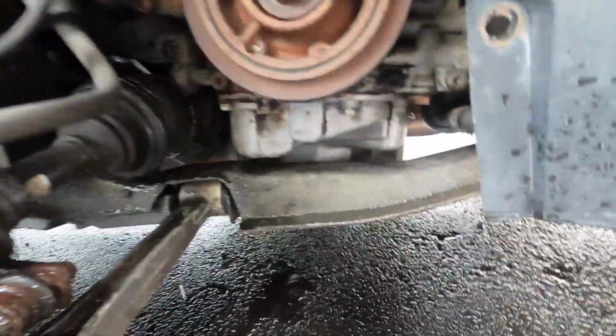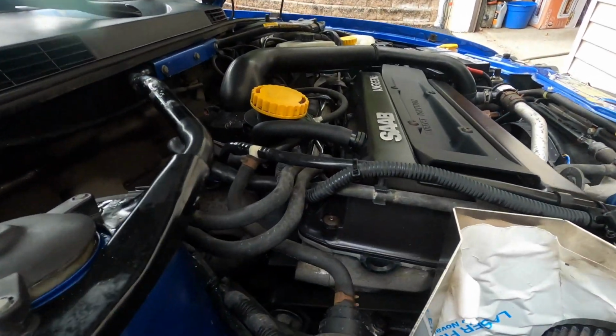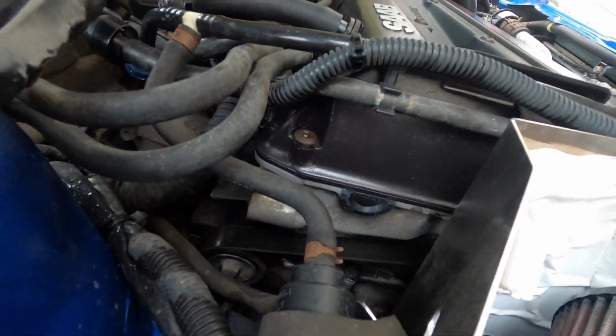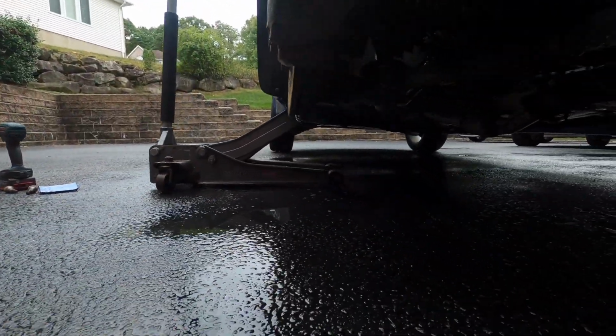I don't see any fresh oil leaking anywhere, which is what we want to see after doing all of that work. Even on the side of the motor here, everything looks good. From what I can tell, I mean, we haven't really driven the car, but if I were to go high speeds and so forth, with 10 minutes of oil pressure, you're still going to run 40 psi at least of oil pressure, maybe more with fresh oil. So we would be seeing some fresh leaks.